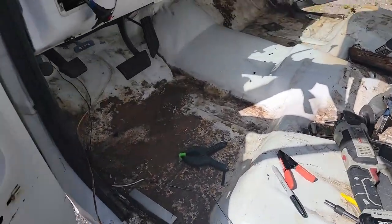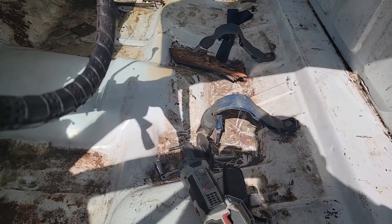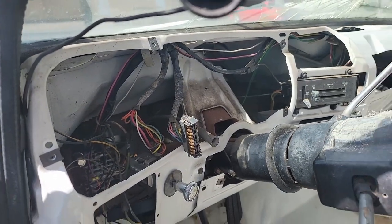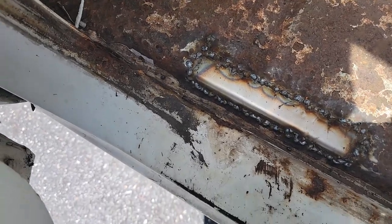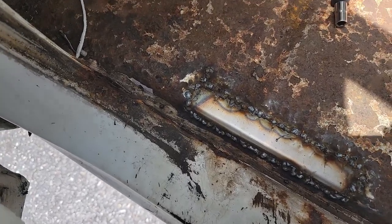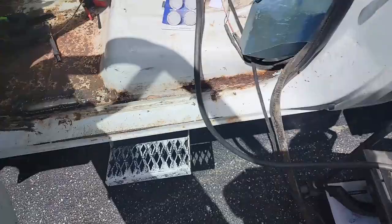Clean that up, rust kill it. Get this whole interior really clean — it'll look brand new when I'm done before we lay the mat in. Welding the rust sucks — forgot how bad it sucks. That's some ugly welding right there but I'm going to grind it back, see where there are still some holes, and tap it, hopefully get some solid welds to weld back to. Because that's how it works: you hit rust, it blows apart and blows apart until you get to a solid part or until a solid weld hits it. This side was better — still ain't good, but there's a little more solid floor to hit. Grind that back and then hit whatever gaps are left.